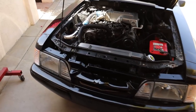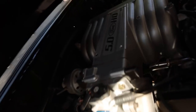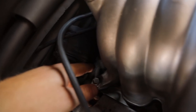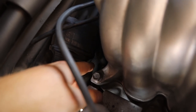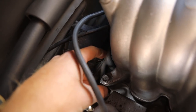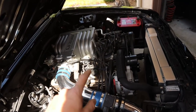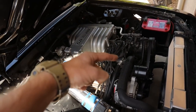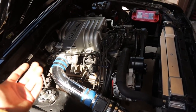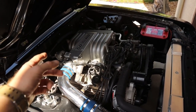The biggest reason it's doing that is actually an oil issue within the intake — the PCV valve is what I'm pretty sure this is. In the very back of the intake, right around my salt and pepper shaker, there's a hose that goes into the back of the intake, and then there's a T fitting that comes off and goes into both sides. The PCV valve basically pulls all the crankcase pressure out of the oil gallery and recirculates it back into the engine. I'm going to pull the old one out and show you guys what it looks like compared to the new one.